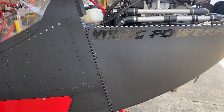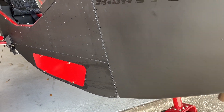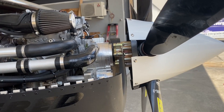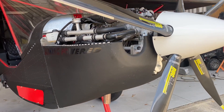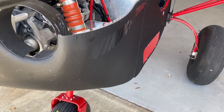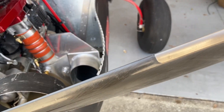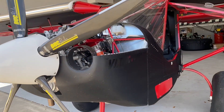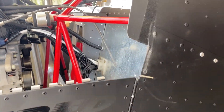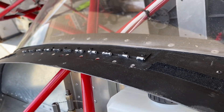The cowlings are held on with piano hinges. It's much easier to do on the Super Duty than other airplanes we've worked on because it's completely straight — no problem there. They use a 3-inch extension in order for the cowling, spinner, and everything to work out, so you would get a 3-inch extension for this one, which Viking has. As you can tell, even the top line of the cowling comes out a little bit. The top cowling is very simple as well — just piano hinges, and a short piece of hinge up here, about 8 inches or so, to keep the cowling from moving back and forth.